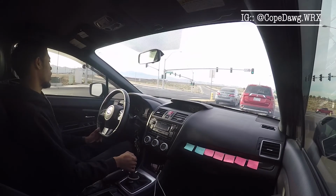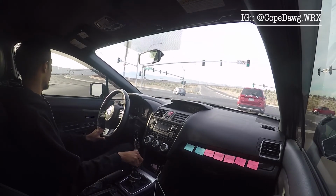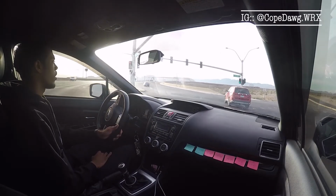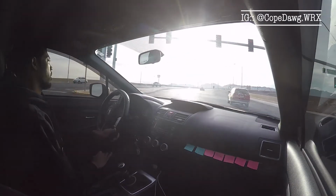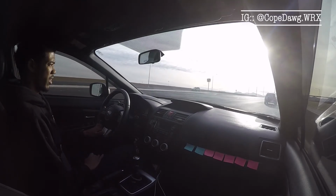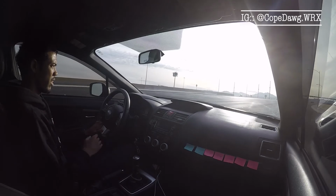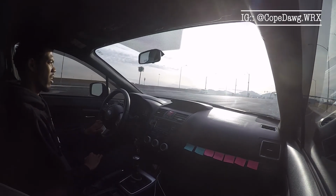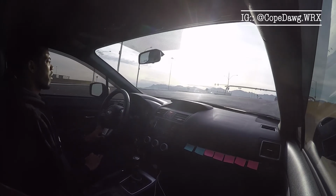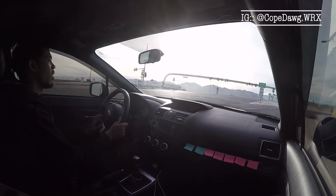Alright, so we're all warmed up. We're sitting at about a 190 coolant temp. So go ahead, hop on the freeway real quick, do a pull. It's always nerve-wracking because it's full load. It's at third gear, 2,000 RPM, and you floor it up basically until you touch redline, about 65. So it's always nerve-wracking, but gotta get her done, eh?